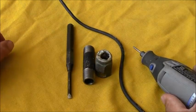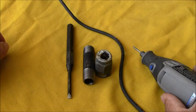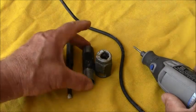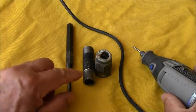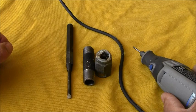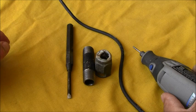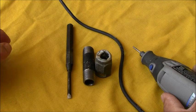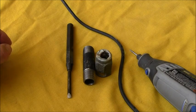I sharpened up a punch for a chisel, went to work very carefully, and peeled out the first piece, getting it out with needle nose pliers. Then I screwed in a new hose barb — went to the parts store and got heater hose and a new hose barb. One of the grooves I'd cut went almost to the bottom of the threads, but with plenty of Permatex on it, it sealed up just fine. As long as you don't go past the bottom of the threads it'll still seal. That little fix saved us hundreds of bucks — otherwise I'd have had to take it to a shop for a new intake manifold.